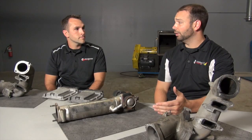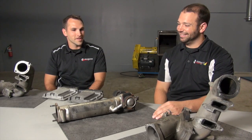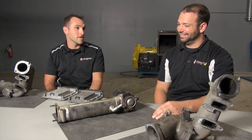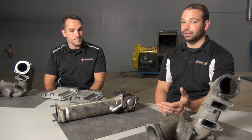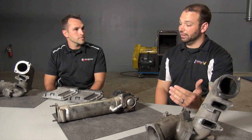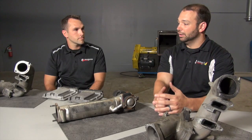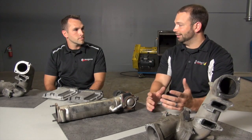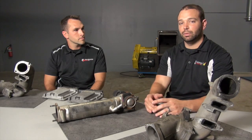We got a pretty solid upgrade though — five horsepower. Yeah, a lot of similarities in the actual hard parts other than the addition of the DPF. Foundationally the engine is almost unchanged. They take the same power, they have the same strength, same weaknesses aside from the DPF. There are a couple of little things that changed and they're mostly around emissions equipment.